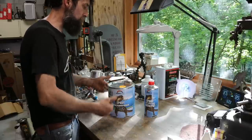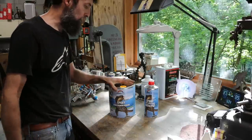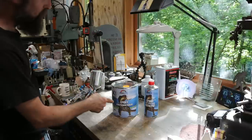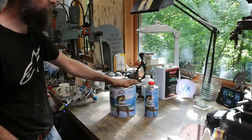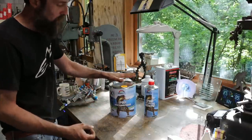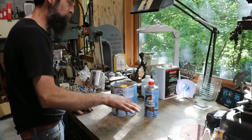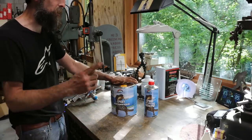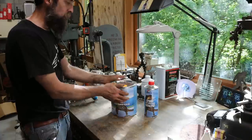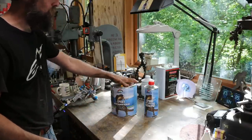Now, this is my non-professional opinion. From my experience, it just sands like garbage and it's tough to work. But that said, I still think it is an amazing product for protecting metal. So what I'm going to do with this gallon is spray it under the bottom of the bed in my truck. There's lots of products you could spray under there, but I'm going to use this because it's a great sealing agent. It's black, dries to a nice satin finish, plus it's super, super durable.